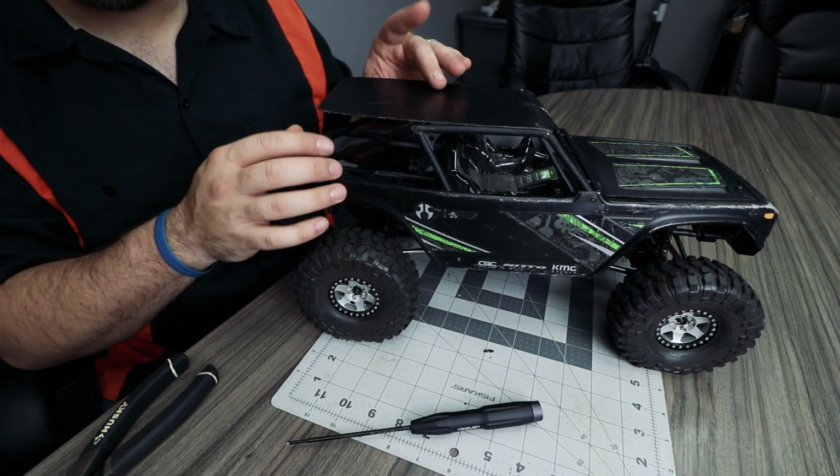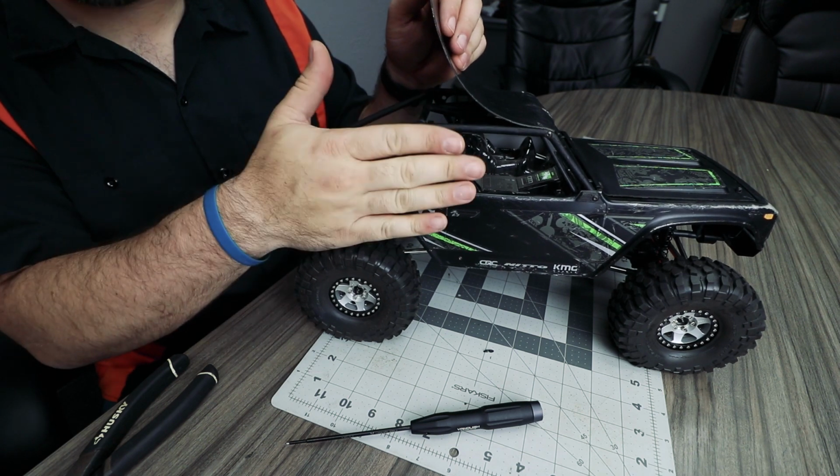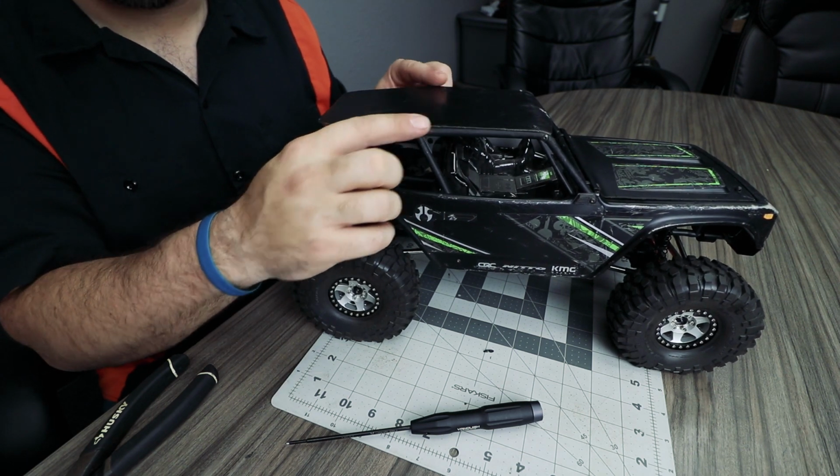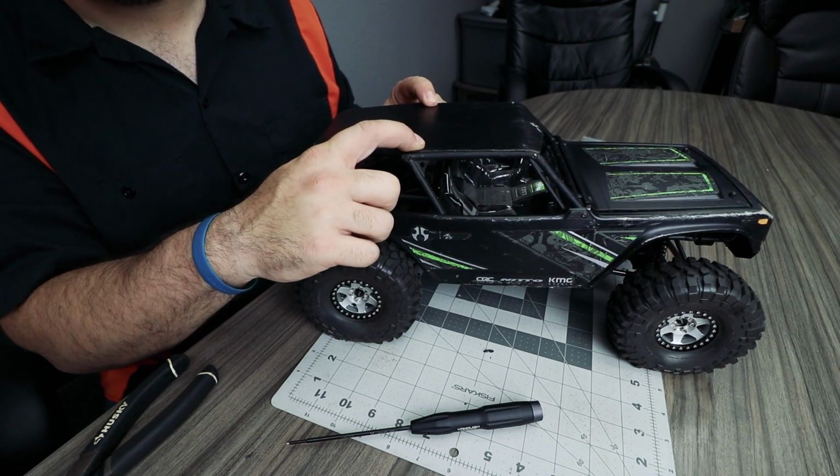One thing to note, if you aren't planning on making a new roof skin, is that since you're putting those links between this top panel and the outside, you do move your screw holes out just a hair on each side. So you will need to open up those holes on this existing roof panel if you plan to use it again.